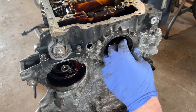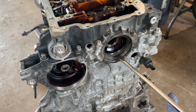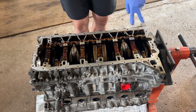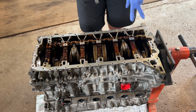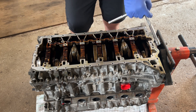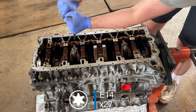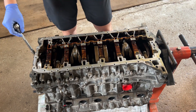Before removing the bed plate, let's try to remove this seal. This oil drain pipe for the turbo needs to come out — there are two bolts sitting higher up that you have to undo first, and then once that's done you can do all the other bolts around the bed plate. Once those are done, you can do the bolts in the middle, which have an order — basically from inside to outside. There are also four bolts where the crank seals are, which are E12.